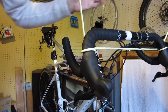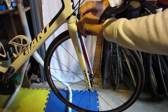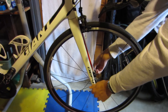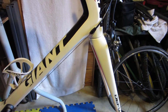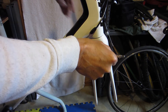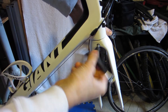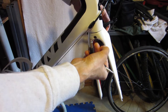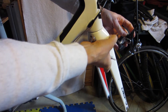Next I'm going to remove the front wheel — just loosen the brakes, loosen the quick release, and out it comes. Next I have to remove the brake caliper; there's a five-millimeter hex in the back. The bolt is staying in there so I'll just leave it.